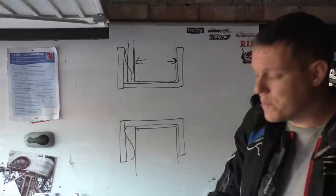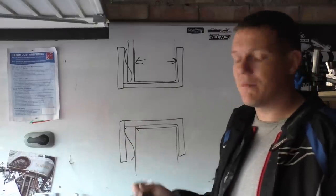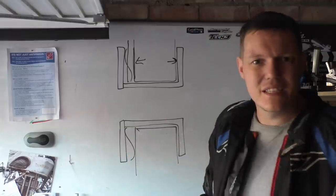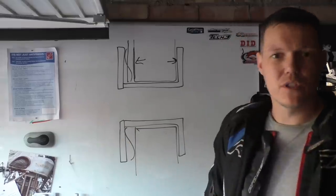The Z900's brand new, them bobbins don't rotate and they don't move. Now you might be able to grab your disc and go like this and bend it. Well yeah, you can basically move against that bevel washer. You're also bending the disc itself, there's a bit of deflection there, there's a bit of a bending moment there. Stuff like that. But these bobbins don't need to rotate.